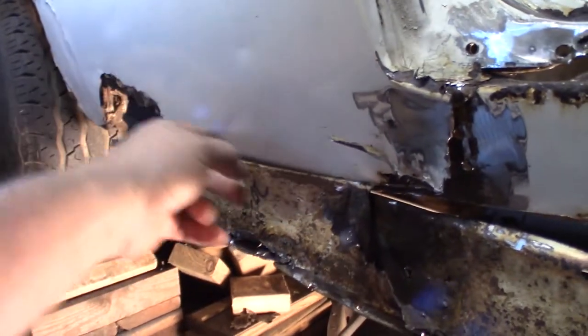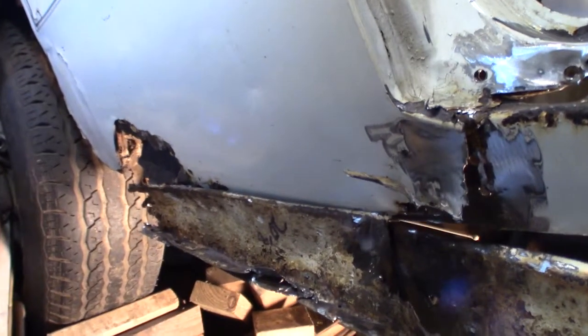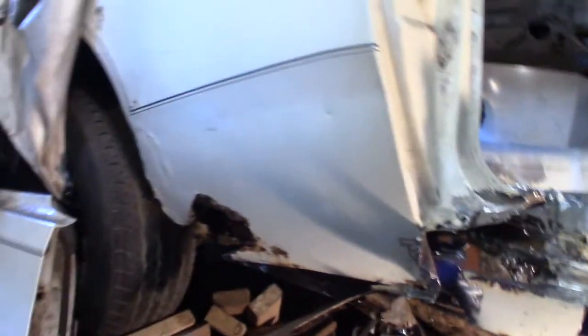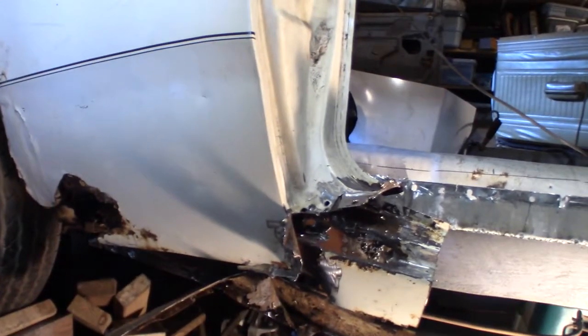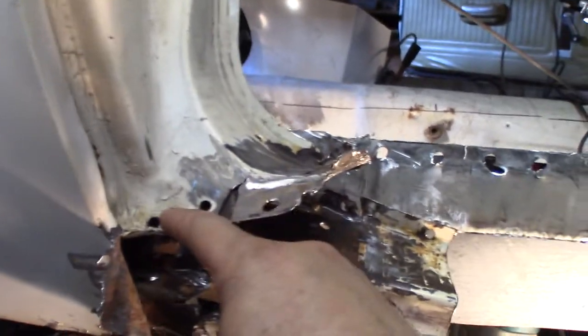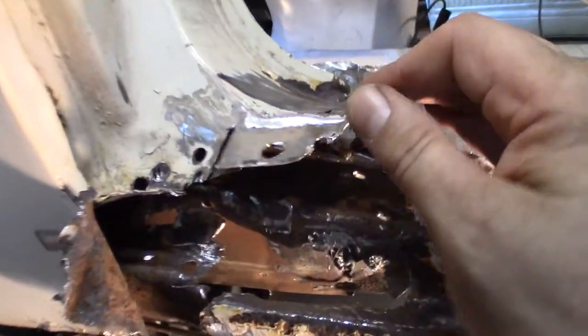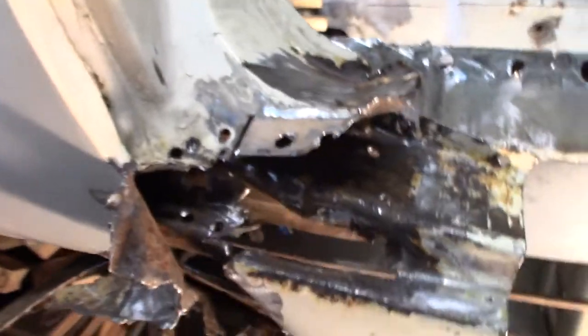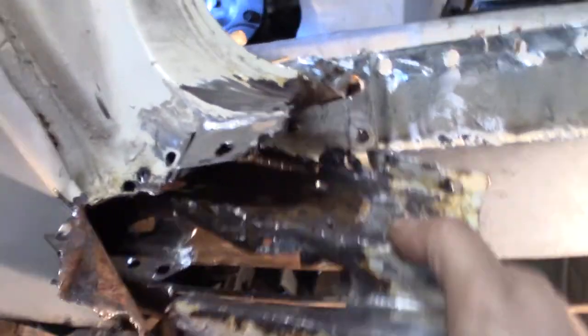I think I got it on the other side because I knew my quarter panel was going and I had a great big hole there that I could get it loose. Hardest part of getting the rocker panel in has to be the back rear quarter panel area. I mean, I've got it loose. It wasn't until I drilled more spot holes on this door jamb. I mean, you got spot welds just all over. So I'm almost loose. It might be that bracket still. It's a tough spot.